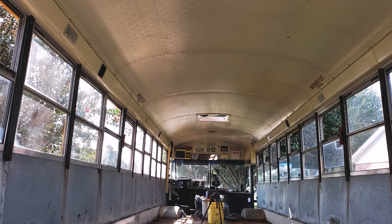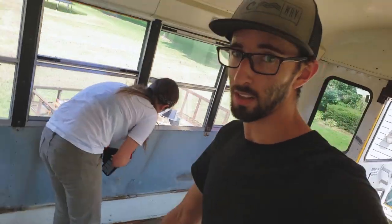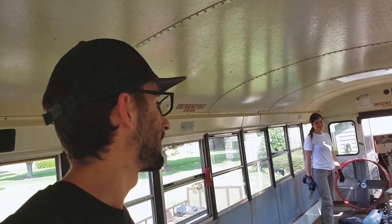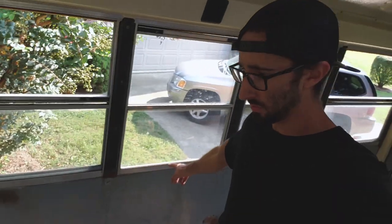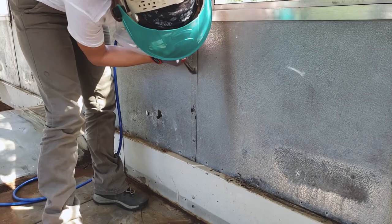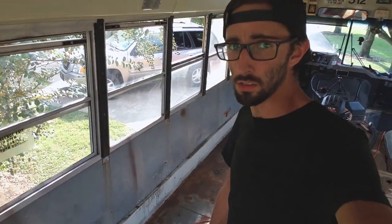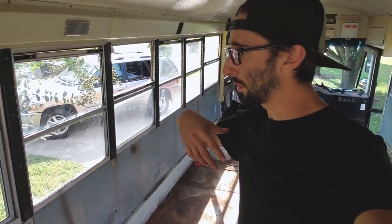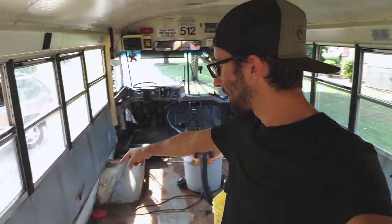All mine are actually out. I'm just saying, winners win - I kind of won, but I also kind of lost because my wife is very, very competitive, but she did good. Some of hers are actually stuck. So all the screws are out. There were a couple that had rounded off, so I just went with the angle grinder and snipped them down the center, then came back with the air chisel and split them in half - very convenient, very simple. Now all these million screws are out. They actually tuck underneath the window sills. We will eventually pull these windows out and reseal them just to make sure they don't leak. For now, we're just going to get the angle grinder and zip down all the sides, get the insulation out, and make just one simple run to the scrapyard.